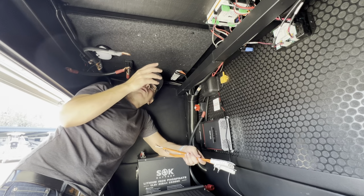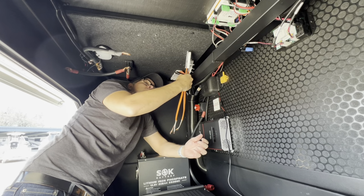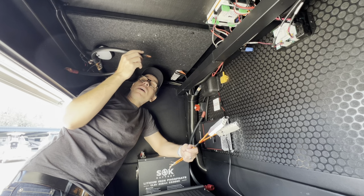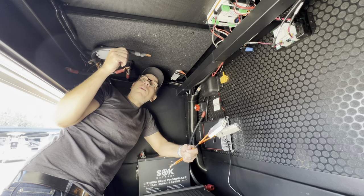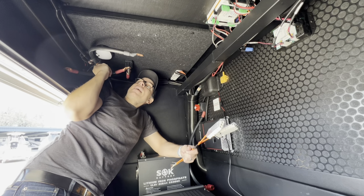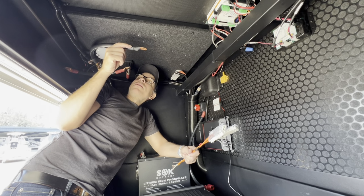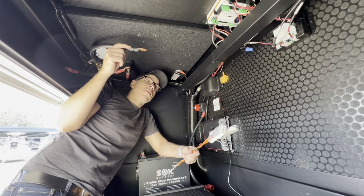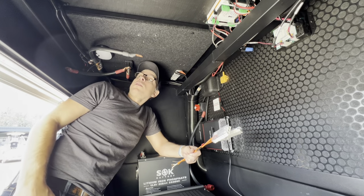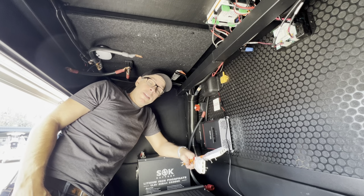But I have been trying to figure out how far forward so I can leave space on the back to connect this connector with this one on the back. And at the same time, these cables on the front are 4-0, very stiff and hard to turn. And I don't have too much room, and I'm here by myself. So I need to figure out the perfect position for this inverter up here to be able to do this. I'm gonna keep trying. Let's see what I can do.